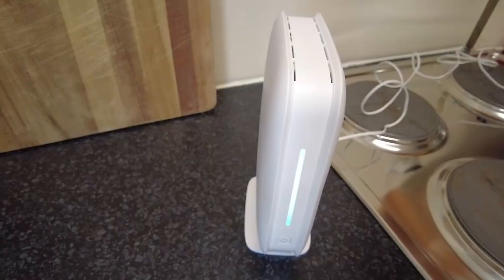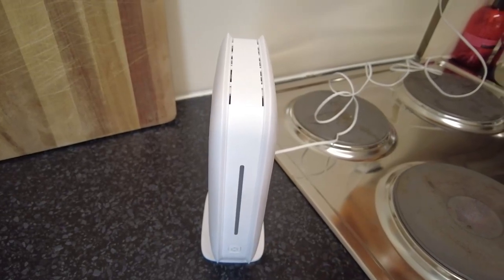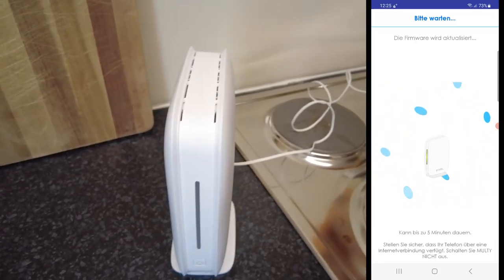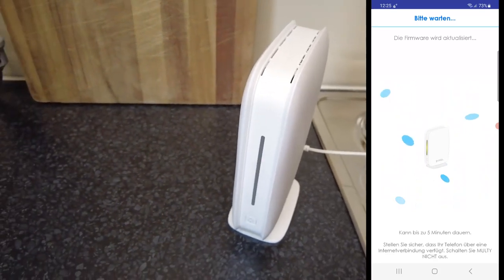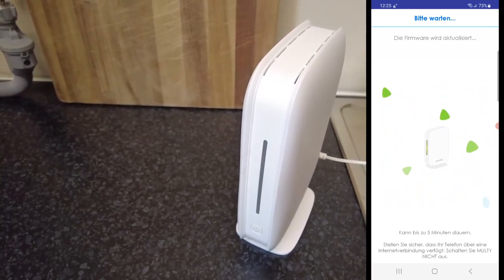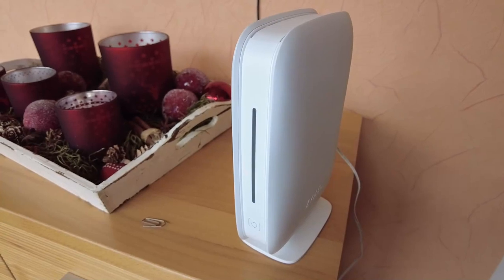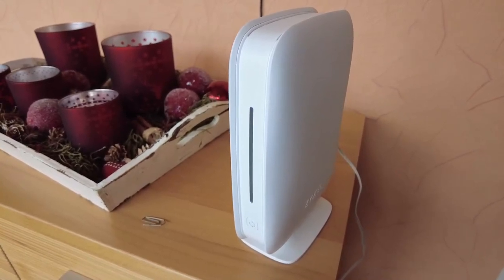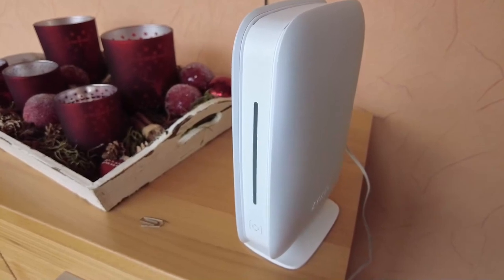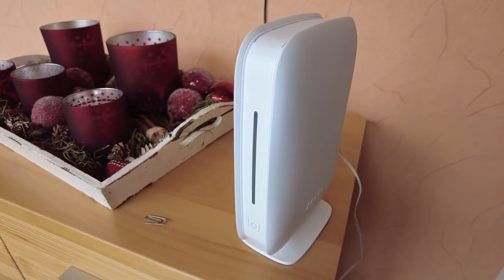Here is the second satellite — the third node to install — and I push the sync button. At this point I forgot that my phone has to be ready for adding the new node; it was busy doing a firmware update for another node. So the node was not entered into the wireless network of the master, and after a time the flashing purple turned back to green and I had to start over. I walked closer to the master node, started the process correctly using my phone to add the node, then pushed the sync button. Within a few seconds the device was added to the network and started flashing green, then constant green. Then I put it back to the desired position.